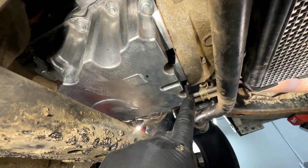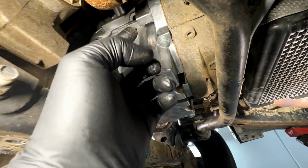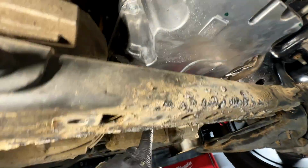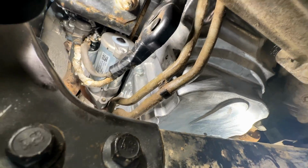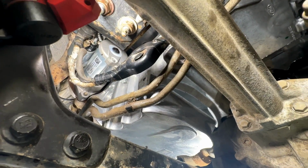So it matches up perfectly around the outside here. All your bell housing bolts down here on the side, and on this side, go into it just fine. Everything's good to go there. There's no clearance issues with the cross member or the front axle on here. You can see there's plenty of room. Like I said, the front axle is standard all these years since basically '09. So everything works on there. Plenty of clearance, looks beautiful, and it's never gonna leak like the two-piecer would about maybe a year or two from now. It's just the way the design is.